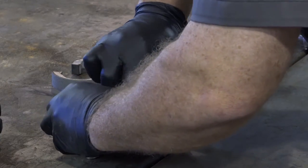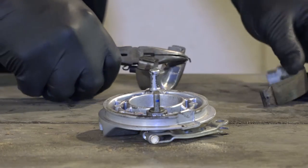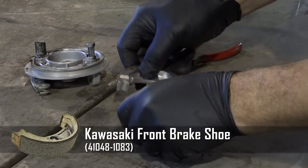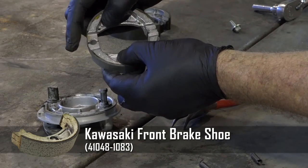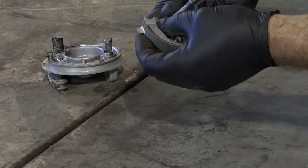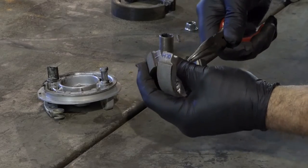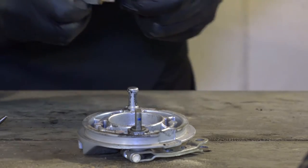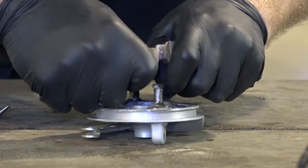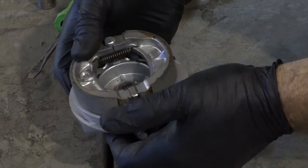These springs are a little tricky. What you want to do is just pull out on them as you're pulling up and then walk it off, like that. Next, let's get these springs off and get them on the new brake shoes. Make sure that your ends are similar — see how it has that little opening right there? These are flat; I want those to match up. That last one's always the tough one. Now let's go ahead and get them stretched back over our hub.